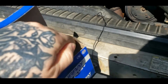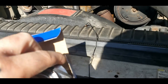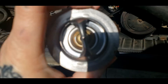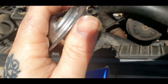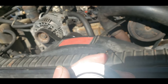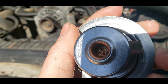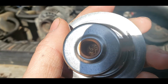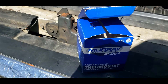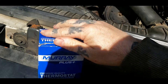I know International puts 203s in them — maybe they put some 208s too. Ford put a different temperature in those engines, I don't know why. This one is a 205-degree thermostat, so just two degrees more. It ain't right on the money when they open or close — it's just a ballpark number.